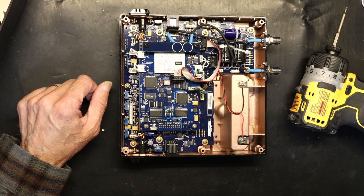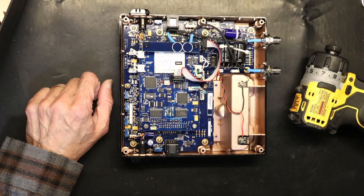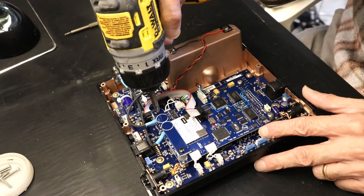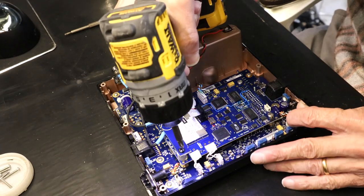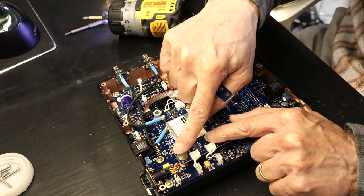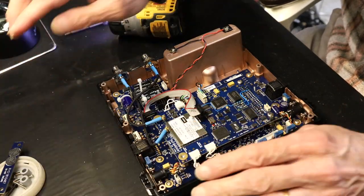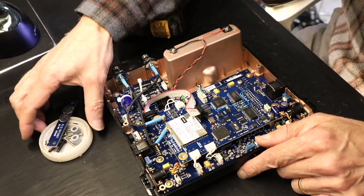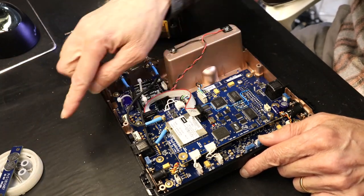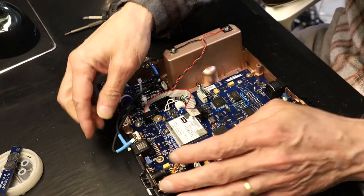So first we need to put back the Phillips screwdriver. Remember I said you need a Phillips and a star shaped. Now is the time for the Phillips. So I'm going to use the Phillips screwdriver to open these. Make sure you don't lose these, so these don't fall. Pick them up and put everything aside. So now I have all the screws, these two guys, and the holder. These are the antenna wires. Remove them gently. Set them aside.